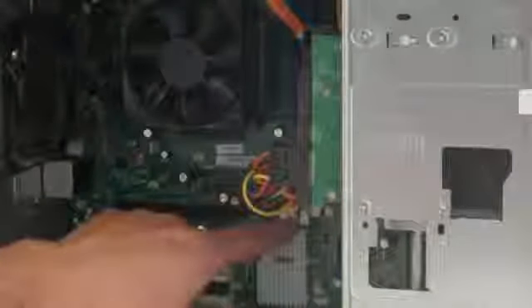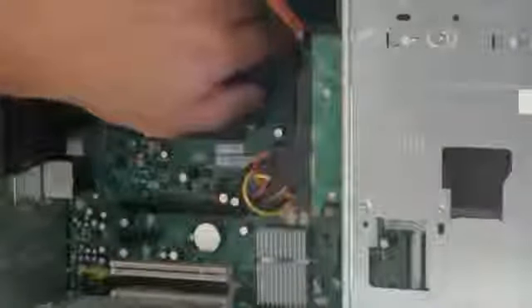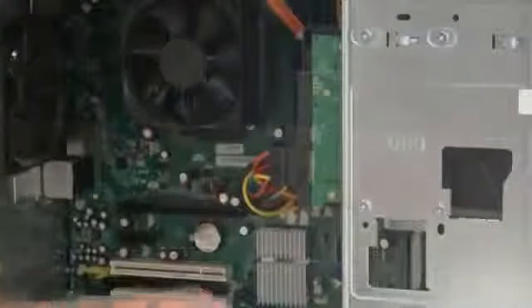You've got a couple of tabs — little white tabs on the bottom. You want to make sure those tabs are pushed all the way down, and at the top you want to make sure they're pushed all the way up — just the opposite — so that you can put your RAM in there. Then take the RAM out of the package.